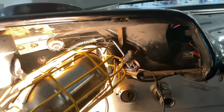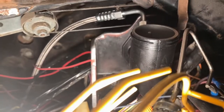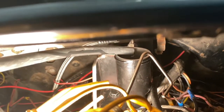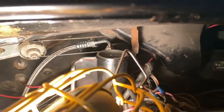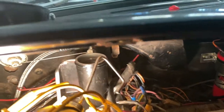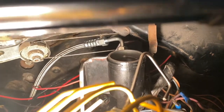Here's the brake bleeding process — I'm up in the car, Jeff's underneath. You can see that's the reservoir and we've got this set up here. Let's jimmy rig this thing together. This is what we've got to do to fill this up in here. We fill it up and send fluid down, then Jeff tells me if he sees bubbles. Can you push the pedal down? Pedal's down — yeah, there were like two bubbles. Good. I'm almost right full, almost gonna overflow on my container here.